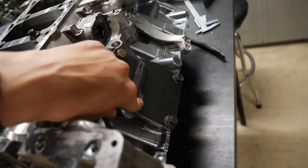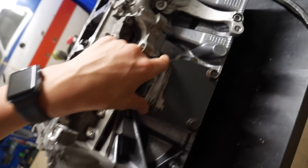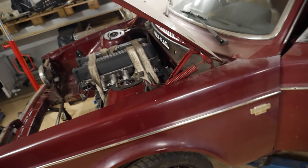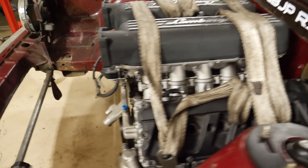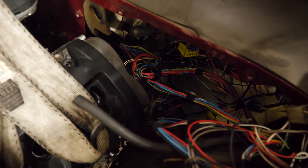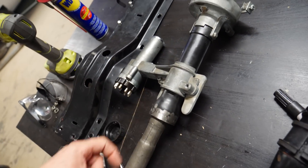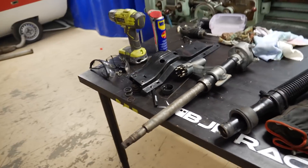I'm going to do some engine mounts. Actually started with some steel plate mounts on the engine — some steel plates and some steps in this one. Just normal steel I found, so no fancy stuff. Should have been aluminum maybe, but to save time I'm doing it in steel for now and can use the normal MIG welder. I actually modified the front beam once again because I want the engine as far back as possible. The steering column down there collides with the oil pump, and the steering shaft was hitting the cylinder head. So I removed it and modified it — cut it off and will do some linkage so the steering axle goes a little lower.